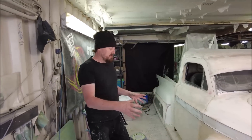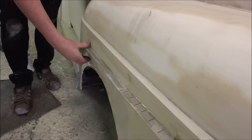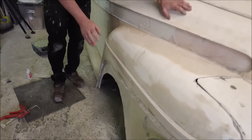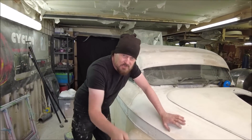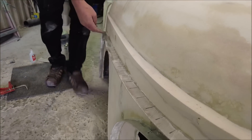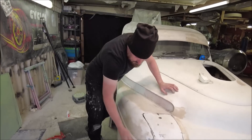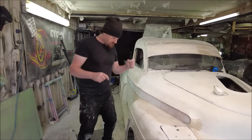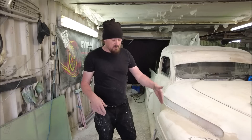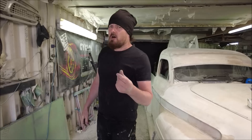That's all glued on. What I'm going to do now is go around and make a small fillet in here of fiberglass paste. This is keyed well — it should stick on fantastic. When that's dry, I'm going to sand this down a bit because I don't want this equidistant sort of gap — I want it to come up and taper in, and I want all this to be a bit lighter because this will essentially be a bit of trim. Most importantly, I'm going to put the fiberglass around it just so that as I'm grinding it, it doesn't pop off. Because right now the ally would get hot, the glue would release, and it would just drop off as I'm grinding it.